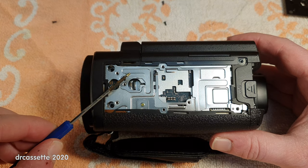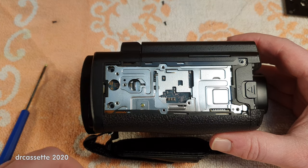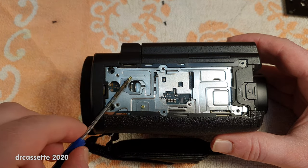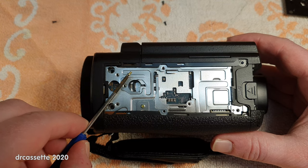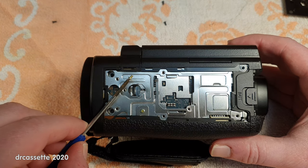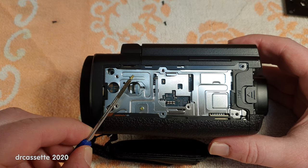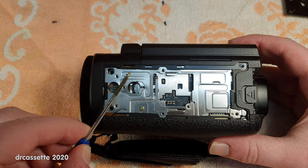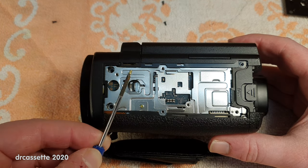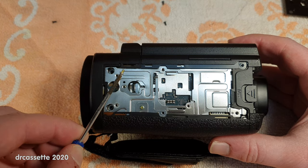What sort of a screw is that? Probably a 1.5mm screw. So you have the giant tripod mount screw, but that is only held to the camcorder body by this tiny little screw. Of course, people will tend to over-tighten the tripod because this tiny little screw is not going to provide a lot of stability. People will think the camera still feels a bit loose, so I have to tighten it down some more. Well, you can tighten it down all you want, because the part that is providing stability is this tiny little screw. That's all there is.